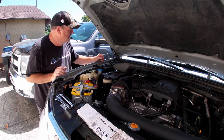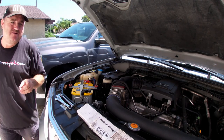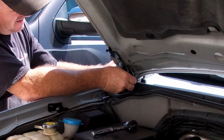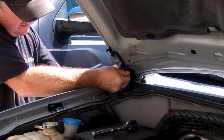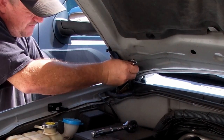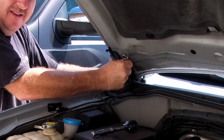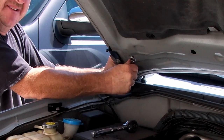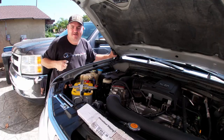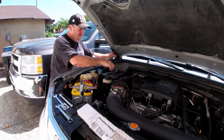But I have this other light bracket, so I'm not going to use the factory hardware on the bottom one. I'll go ahead and use the M8 by 1.25 nut and put my light bracket back on. That nut is a 13 millimeter — I'll go ahead and tighten it. I want to get it tight without stripping it. The light is solid, the hood is solid. You could put a little bit of Loctite on that one since I don't have a lock nut or lock washer, but I didn't do that.